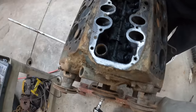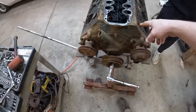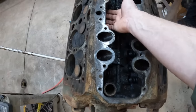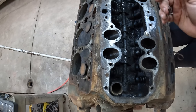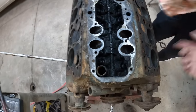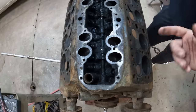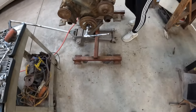Super clean. Before we do anything else in there, Caitlin's going to grab the water pumps off the front. We've got to remove all those valves, with a tool we're going to have to build to pull the spring down to remove the retaining clip that's up here. There's a retaining clip on the top of each of them, a little horseshoe clip, so that these valves can come out of the top of the block. Then we're going to flip it over, pull the oil pan, pull the crank, and remove the piston before we pull the crank. So that's what we're doing, tearing it all down.